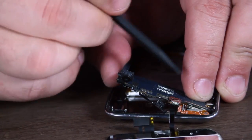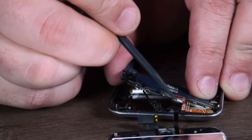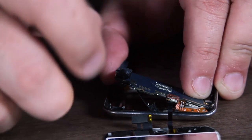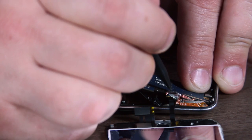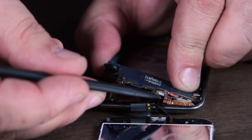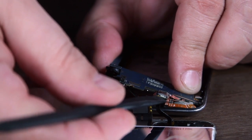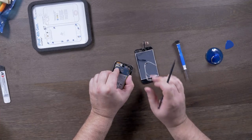The digitizer cable is held onto the logic board underneath with a ZIF socket, and it has a piece of copper tape wrapped around it for shielding and to aid in holding it in place. We're going to gently peel up this copper adhesive starting from the inside edge, laying it back, then dislodge the other half. Take the flat end of the nylon spudger and insert it along the cable — only going in to where you feel the spudger stop; do not force it in. Once it's in, push slightly downward and the cable will become dislodged from the logic board, and then you can slide it out as a singular piece.